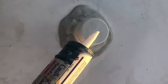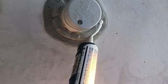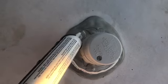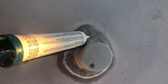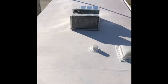I've prepared our caulking gun with the Rubex caulking and the surfaces are clean. I'm going to carefully apply a liberal amount — just get this flowing through here and slowly run it around into the crack. Let it settle and then come back and hit it up again to ensure it's sealing well. I'll just slowly work my way around this vent and continue to do that all the way around the trailer.